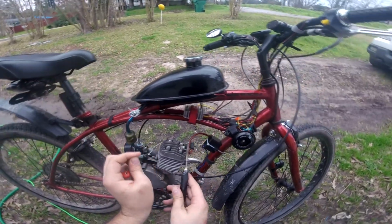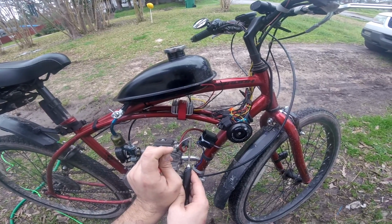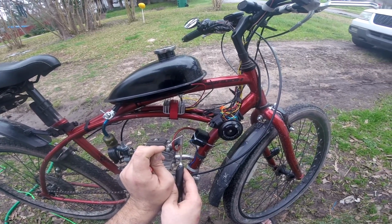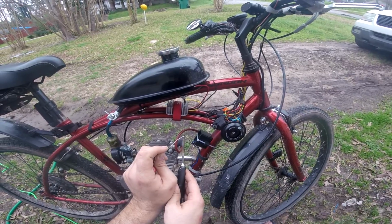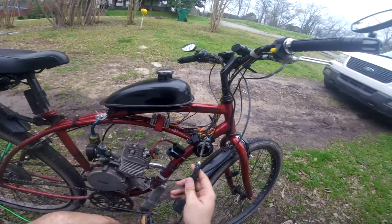My second tip would be that before you solder or desolder anything, and after you've cleaned it, put a little bit of solder on the tip. This will help quite a bit in soldering the new components or desoldering. It helps transfer the heat much faster.